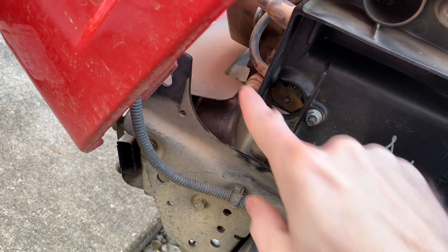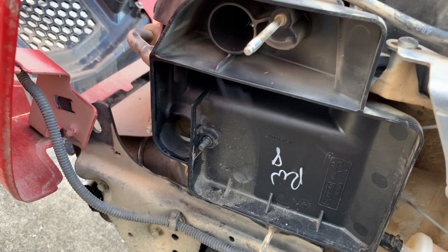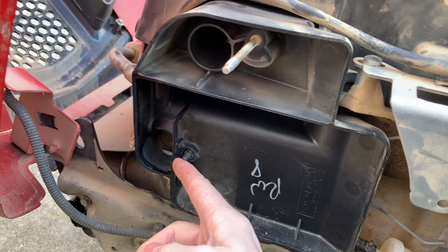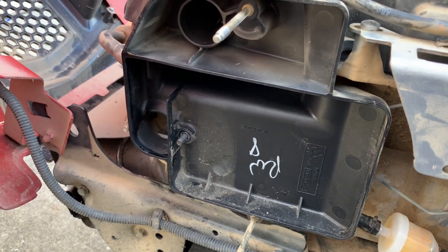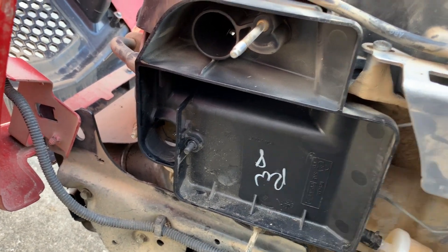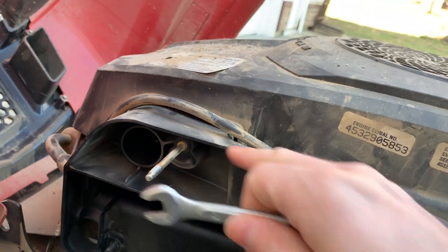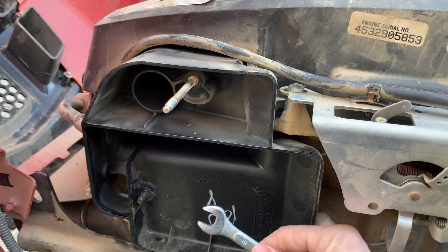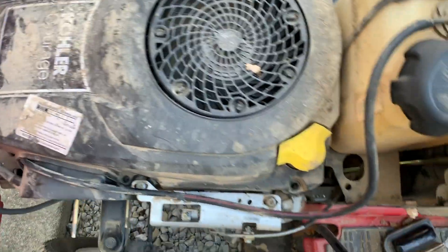I assume I have to start taking apart here. That's a 10 millimeter nut that came off, but it's too close to the sidewall to use a socket on - so a design engineer said get a box wrench and get it off. I'm going to take off this cover - I'll show you where the spark plug is. If I take off the top engine cover I should be able to see something else that holds this airbox on, because it doesn't come off yet - I'm sure there's a mounting post up there. It's 38 degrees out here and I've stupidly decided to work in the shade.